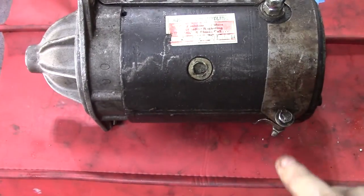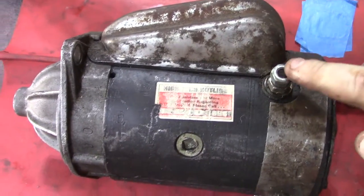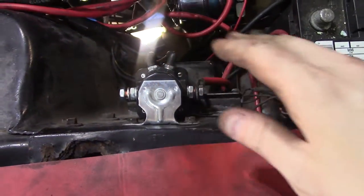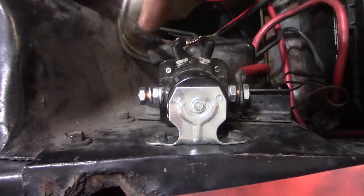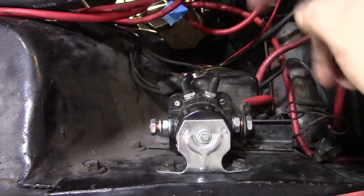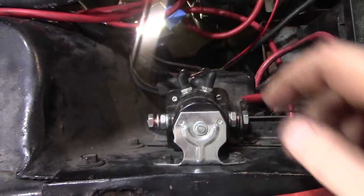Here's the original starter that came in the car. This starter just had one big hot wire to it, and that hot wire came from this side of the starter solenoid. The starter solenoid is on the inner fender of most of these old Ford cars, so it would have hooked up right here and gone straight to the starter. When you turn the key, this solenoid takes 12 volts from this side and shoots it down to the starter.